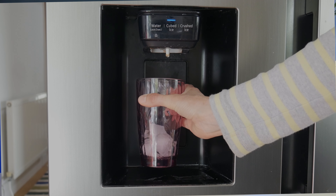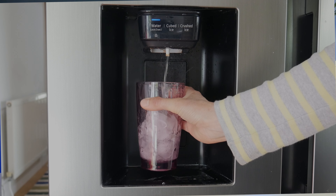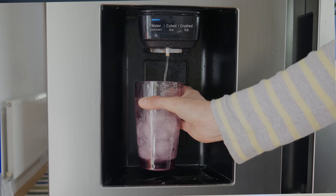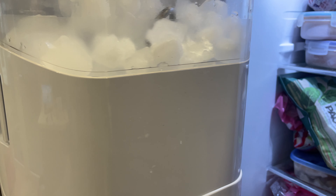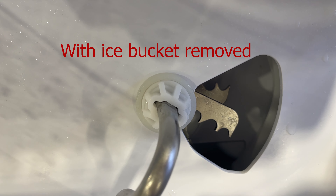Finally, the ice maker — I wanted one of these for years before we got this fridge freezer. On the whole it has been really good and I particularly like having the filtered water dispenser, but it's got a little bit cranky with age. If you don't use it for a couple of days and then try to get ice out, it goes into a phase where it's really noisy for no good reason. It can be because of the water feed or because it needs de-icing, but in this case it's actually a mechanical part under the ice bucket that makes a loud clunking noise — and that can go on for hours and sometimes days.